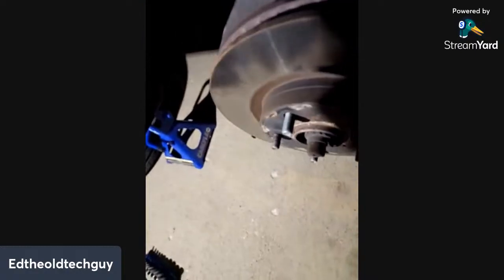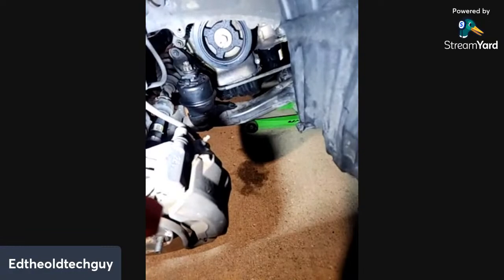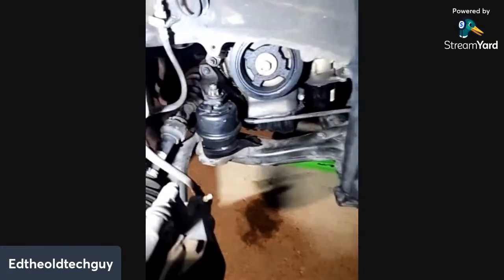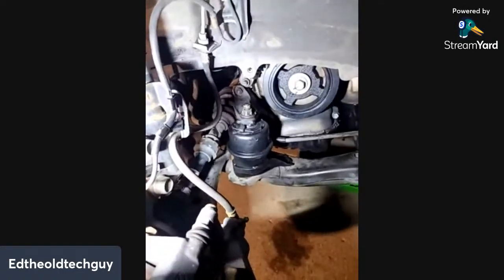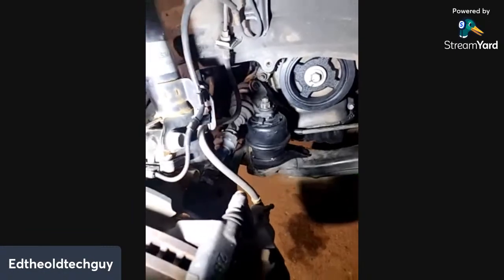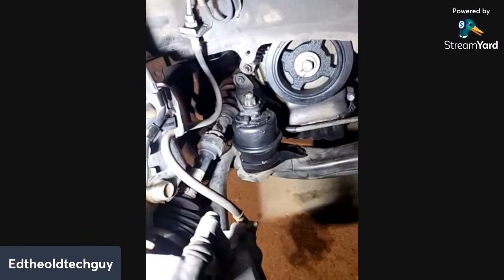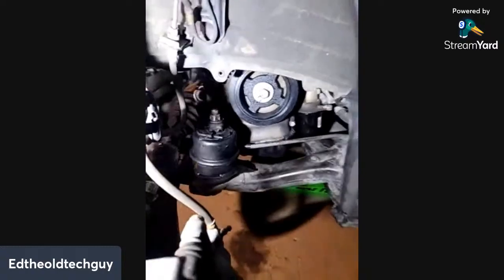So, at the sake of repeating myself, this is a 2009 Toyota Camry, 2.4 liter four cylinder engine with four motor mounts. I just did the motor mounts. Look at how pretty they are, and they are very well aligned. They weren't aligned right before. I found out that the transmission mount was installed incorrectly. It was torqued and forced in, and it was causing a lot of the trouble here. The other thing causing trouble was the harmonic balancer. That's replaced.